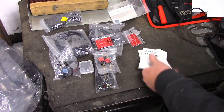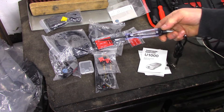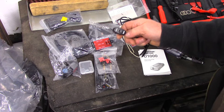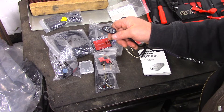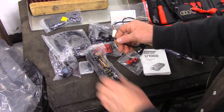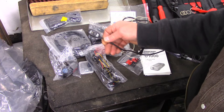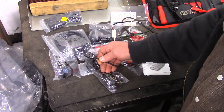What you're going to need for this job is a 12-volt tester to find constant power. I'm going to use this switch from my old LED lights — you can use any switch. When I start my truck I hit this button, I've got power to my camera. I shut off my truck and leave and I still have power to my camera — it is not running in sleep mode, it's running continuously. The cables are really small so I can't imagine it drawing much power. You can actually set it to shut off if voltage drops below 12.2 volts on the main battery.